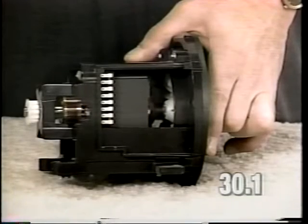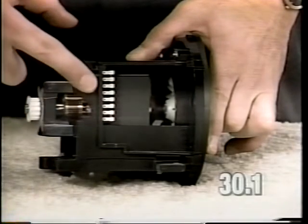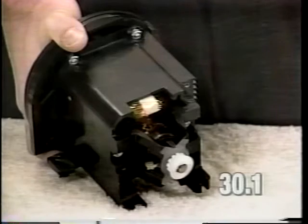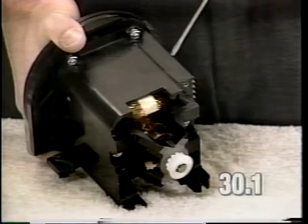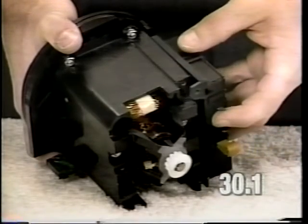Install the power switch to the motor assembly, making sure that there are 8 terminals in place on the field coil and all of the terminals are straight. Rest the power switch up against the motor housing in this area to use it as a guide to avoid bending the terminals on the field.